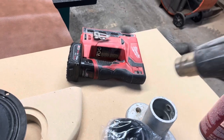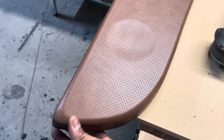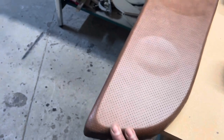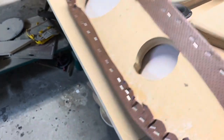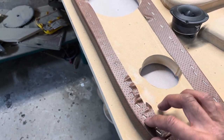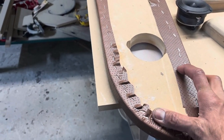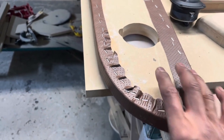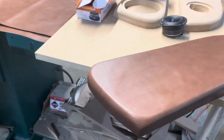In this shop I used DeWalt and Milwaukee — can't beat it. You're going to need a heat gun for your vinyl. This vinyl is great vinyl, it's made by Keystone. In order to get it all wrapped smooth, you're going to want to lay down everything flat, then heat in sections and pull and use your staple gun. Make sure where it wants to lean up and give you that crease, you push it back far enough and shoot a staple so it's not on the outside where you can see it. That way you'll have a nice smooth finish and a great product.